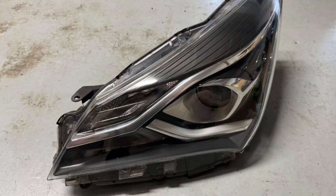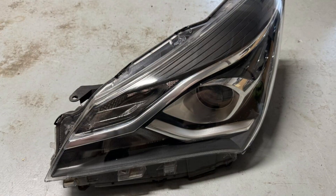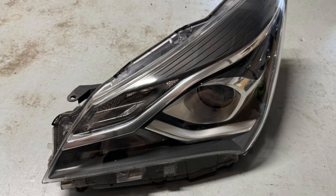It's not that common, but any physical damage to the headlight can also cause this problem. If the headlight is cracked, water may get inside. Even any minor damage to the plastic body or glass of the headlight may actually trigger the 'headlight system malfunction' warning.